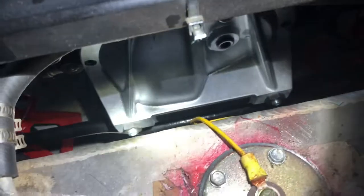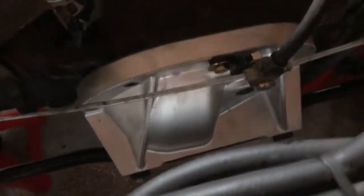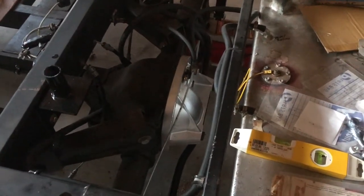I put the Cobra sticker emblem on upside down, which I figured out quickly when I realized the cutout has to go around the ring gear. I also got a nice little surprise in there — the ring gear is stamped 3.08. Street Beasts, as I like to call them, clearly states in their literature that you're going to get a Mustang 8.8 differential with a 3.55 or greater rear-end gear. I guess they figured 3.08 was close enough. No big deal anyway, because I'm running a standard transmission — the TKO 600.